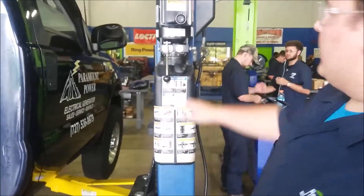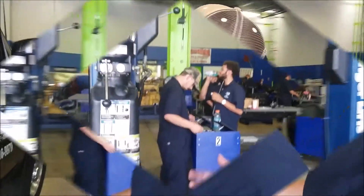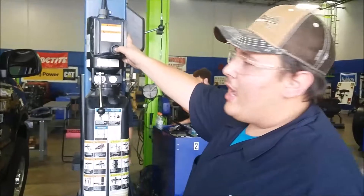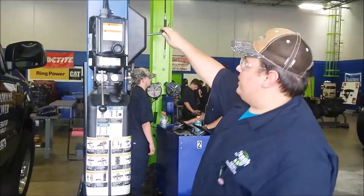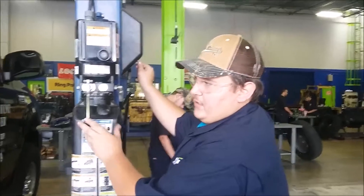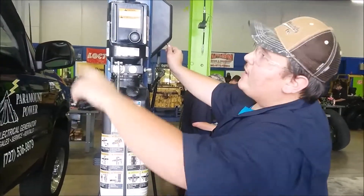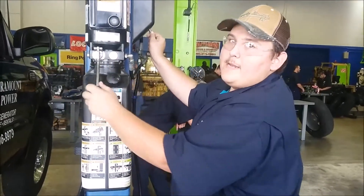Make sure all the hydraulics are down. You're good to go. Now, when you set the vehicle down, you're going to push the button and pull it up off the locks. Grab this handle right here which releases both locks on both sides of the truck. Take the same handle and release the compression a little bit. Make sure that both locks that come unhooked have the locks coming down evenly.